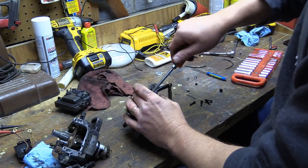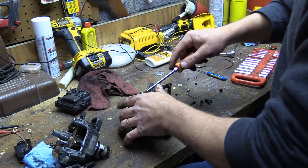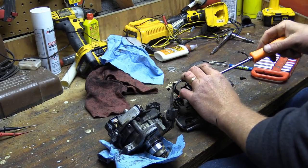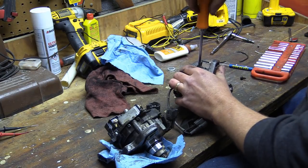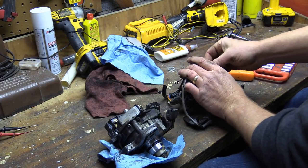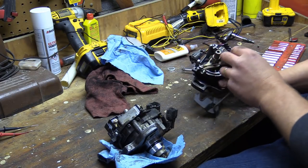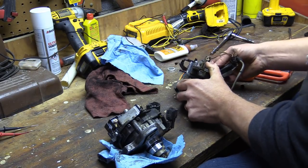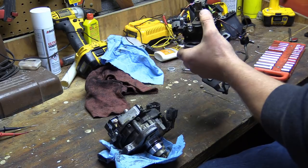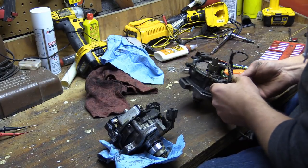Based on the symptoms this thing had, how many people would have suggested plugs, wires, cap and rotor? That would not have fixed it. We're going to use the ignition module out of the distributor that was already in Jake's car, swapping out the module. We're just going to use the pickup coils and hoping they're in good shape. Some of you are thinking we'll do a resistance measurement of the pickup coil — the problem is it doesn't tell you the whole story. It only tells you the winding condition, nothing about the magnet or the motion.